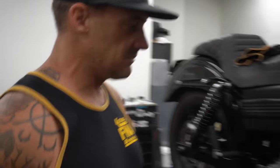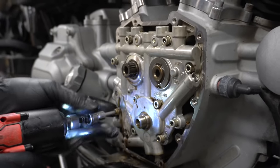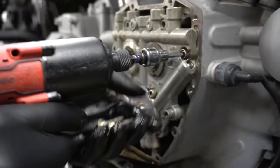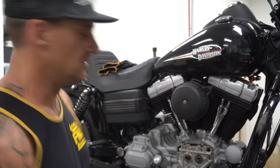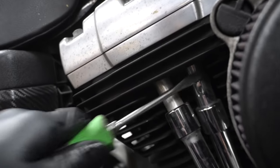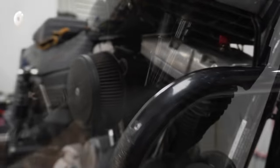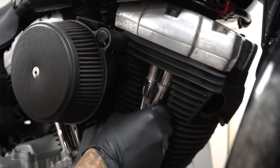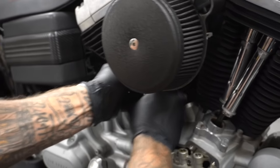I'm going to leave the oil pump bolts bolted to the cam plate because we're not putting in a different oil pump. Now we've got to get the push rods out of the way. Push rods have all the spring pressure pushing down on the cams — I can't pull this shit out right now because it's under load. Push rod, screwdriver, little retainer tab right here — just pop it out. We're putting in adjustable push rods with new tubes. They're usually baked in place because the O-rings have been cooked for 40,000 miles.